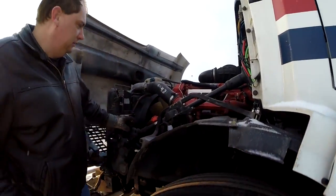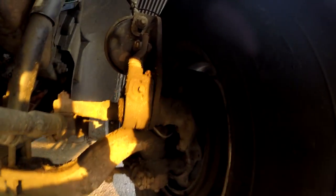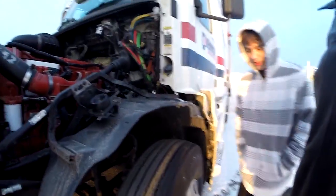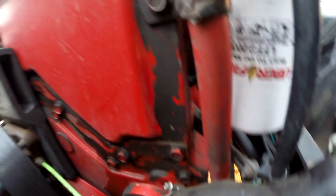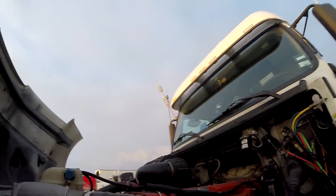Trucker Jukebox, why are you doing this to me? All right, oil is checked — we're still in good shape. Let's look at our brakes. Everything looks good over here: the spring looks good, the slack looks good, the tire is good. You're always supposed to check the slack of the steering. This is the front of my engine and it's seeping a little bit with oil — you can see over there. I want to get that fixed next week, but they just didn't have enough time. Just checking all my lights on top.